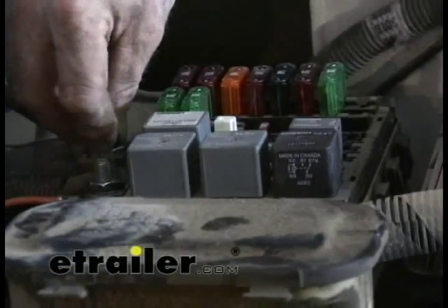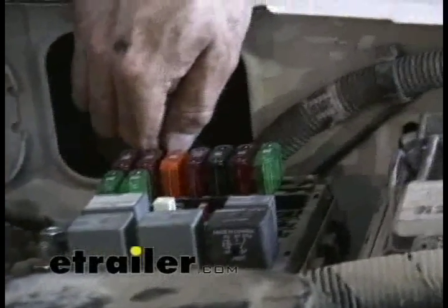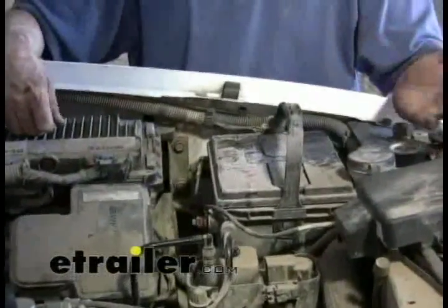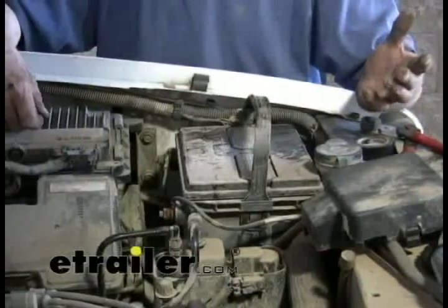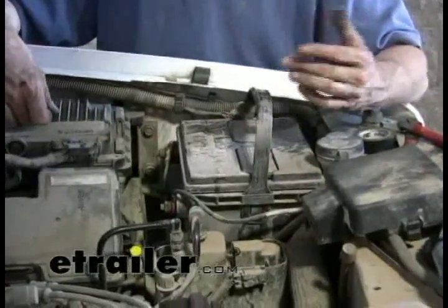Another way — it's not recommended by the manufacturer, but it could be done technically — you can come off this post here, which is supplied by a 30 amp fuse, and then come off here, go to your 20 amp reset breaker so it's still fused to the right amperage, and make your connections here for the positive. You could run your connection to where this battery connects to the frame or body. Because sometimes you run into a situation where the connections are already corroded up, and it's probably not in the best interest to take them apart again, because you might create a headache you're not prepared to deal with.